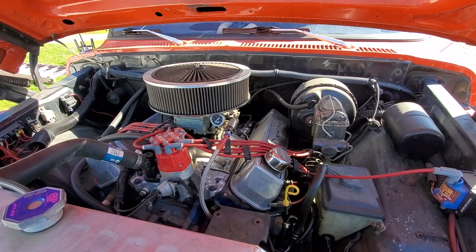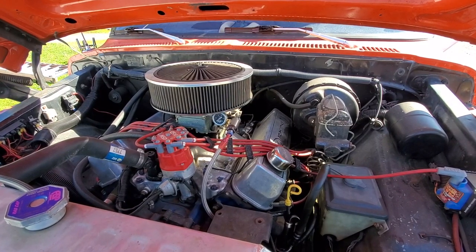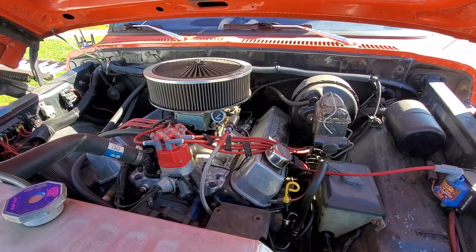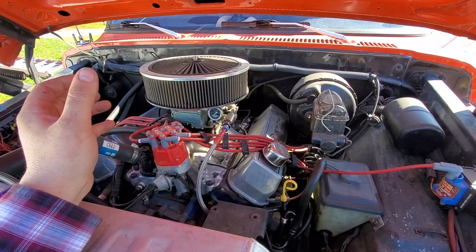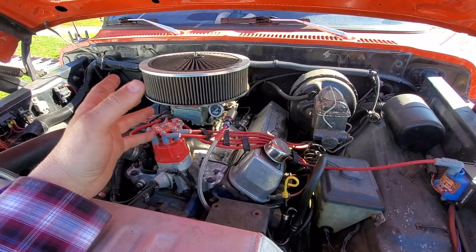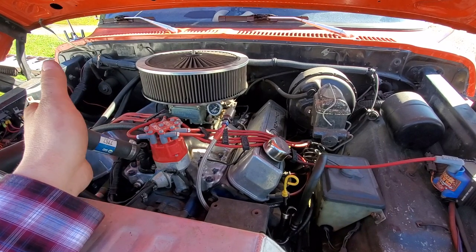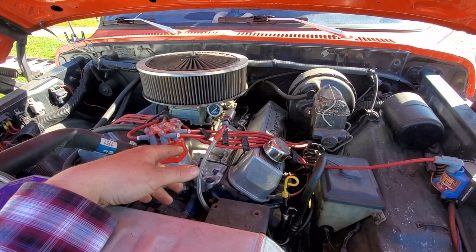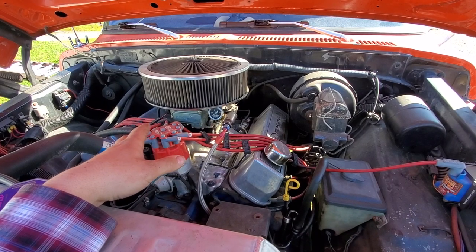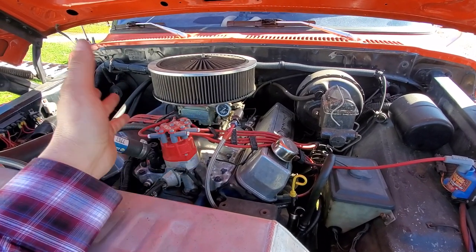We have a custom camshaft in here — I don't recall the specs, but I'll put the camshaft details in the description because I have a photo of the original cam box. The camshaft was done, the heads were reworked a little bit, and we have the Edelbrock Performer intake on there with the 670 Holley — the Truck Avenger version. We did have to do a lot to retune this Holley. The IFR bleeds were drilled out and the emulsion tubes were modified to run a different jetting system so it didn't run overly rich. Even the guys from the performance warehouse went over the specs and kind of scratched their heads. So we went ahead and rejetted it and everything else to keep it from running rich.